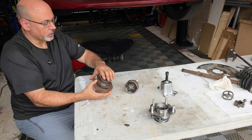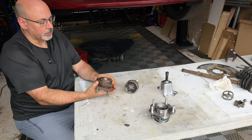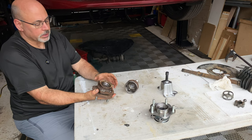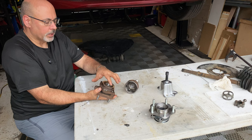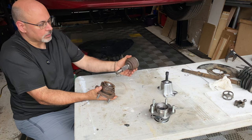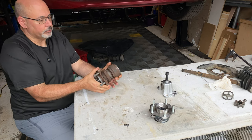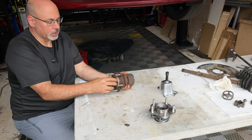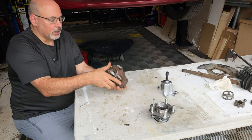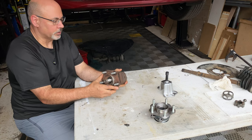This is a driven bearing, but in the back of this car there's likely the same kind of bearing. In the case of Tesla, they use a bolt-on wheel bearing too — it's just going to be bigger. As far as getting rid of the click, you're not going to get rid of this play entirely. You can torque it — that'll help. You can grease it — that'll help. But chances are the click will come back because the grease gets moved out. If that nut is loose, you're going to hear it every time you accelerate or decelerate.